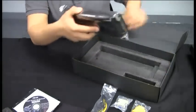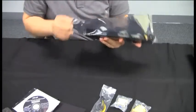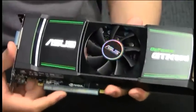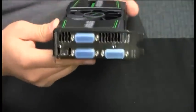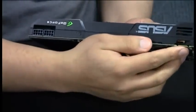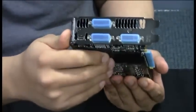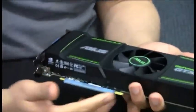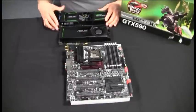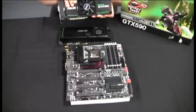Let's take a look at the card itself — the GTX 590. From power connectivity we've got dual 8-pin, an SLI bridge for quad SLI, 3 DVI ports as well as a mini DisplayPort. The 3 DVI ports allow for native 3D Vision Surround. And your standard x16 interconnect. We're going to take a look at the overall dimensions and fit on a modern generation motherboard alongside a standard ASUS GTX 580 for comparison. As you can see, overall not too much of a difference — pretty similar, just a little bit longer, but in most situations it shouldn't impact usage in a good quality mid-tower to full-tower chassis.